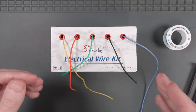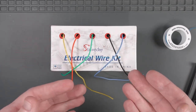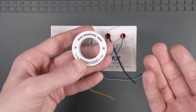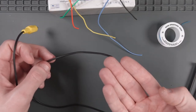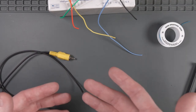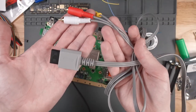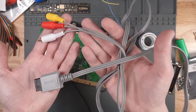We're also going to need a couple different types of wire to hook the PMS up to the trimmed Wii. I have some 24-gauge silicone wire to hook the voltage lines from the PMS up to the Wii, and some 30-gauge wire wrapping wire for some of the signal connections. I also have a piece of composite video cable wire. We're going to use the composite video output from the trimmed Wii and wire it to the Wii AV port to test it on a TV. You'll also need some uncut Wii composite cables to connect to a scaler or TV.